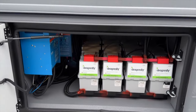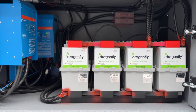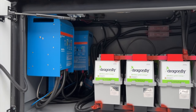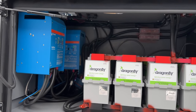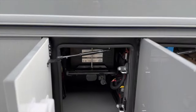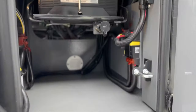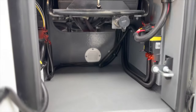Moving forward, we've maxed out the battery capacity on this unit: four 270-amp-hour Dragonfly lithium batteries along with two 3,000-watt Victron Energy inverters. One of those inverters runs your center AC, so you can run the AC going down the road without running a generator — a really good feature. The very front bay on the driver's side has your chassis crank batteries, the connection for the air chuck to fill your tires, and fuses. All outside bays are heated via forced heat from your AquaHot furnace.